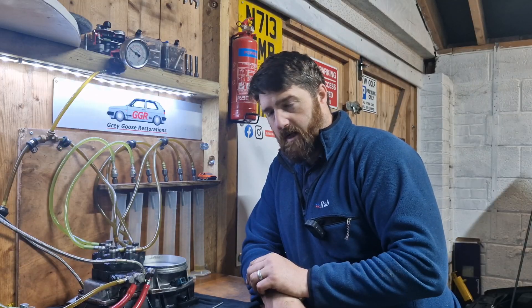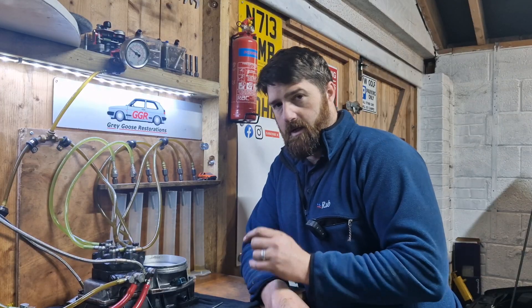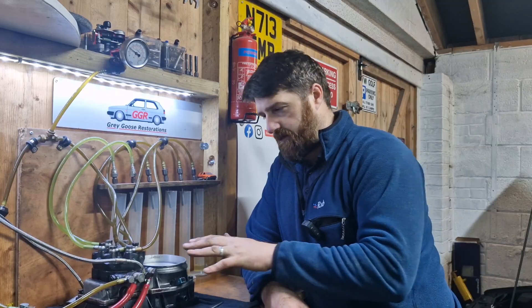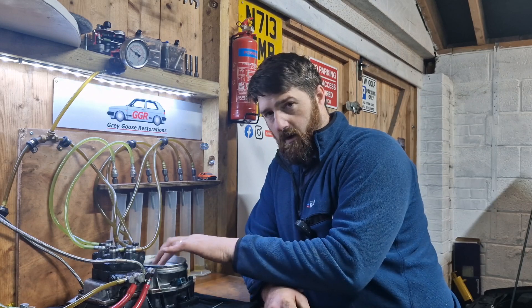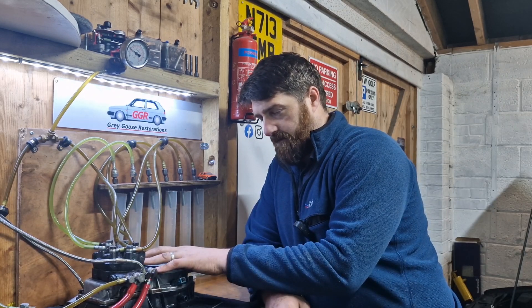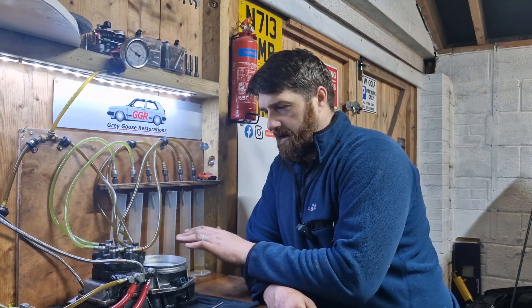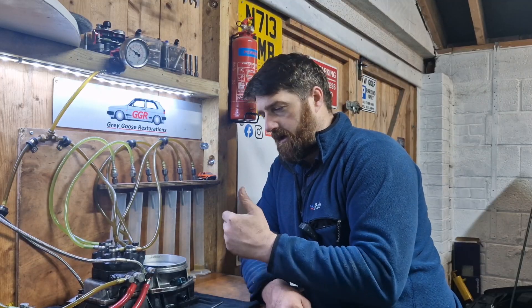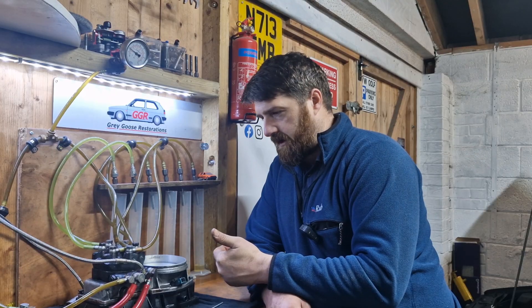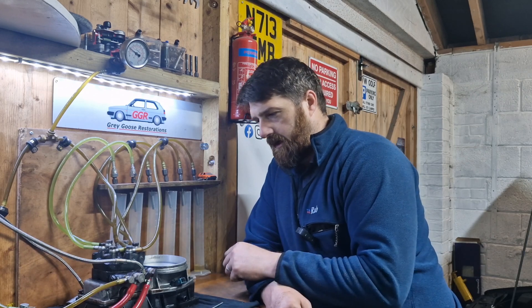Pressurize it for five to ten seconds - if you've got anything coming out, even a drip from one of them, turn it back another half turn until you've got nothing coming out. Then measure the plate at the rear point of the cone - 2mm is a simulated idle position. Every car's different; different cams, compression ratio, worn piston rings, air leaks all affect how high that air plate lifts. As a base setting, 2mm plate lift and injectors delivering about 8 to 10cc of fuel in 30 seconds is enough to get the car running. Once running, let it warm up then move on to getting the CO percentage correct for the car's spec.